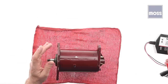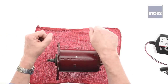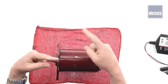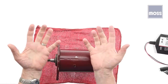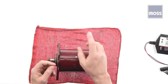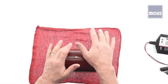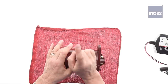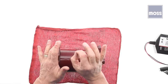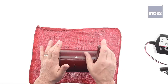Now in a typical setting, if our battery is discharged, we haul out the jumper cables, connect them to start the car, and once it starts, we remove the jumper cables. With the car running, her own charging system will come to life and recharge the drained battery. That's true, and most of us have done it that way since tires with tubes were state of the art. The issue is this: the car's charging system is capable of recharging the battery, but that's tough on the battery and it's tough on the charging system.